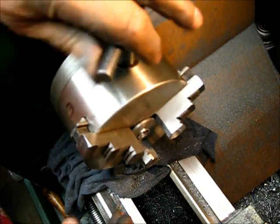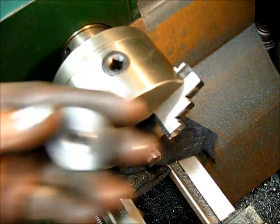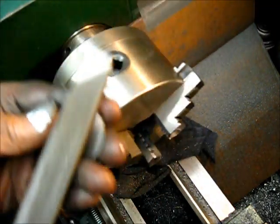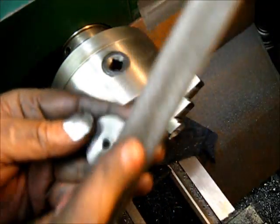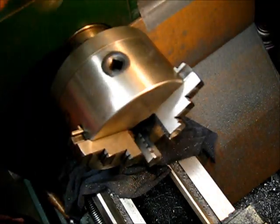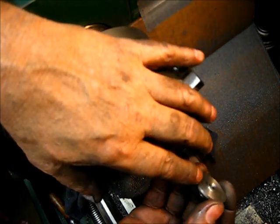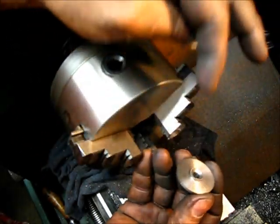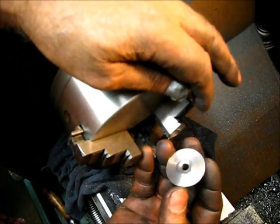This is actually not a very time-consuming project once you get started with it. I'll show you something — we got a little curled-over burr right there. You don't want a curled-over burr on your thing right there. Y'all see that? It's got that taper in there, and it's about a sixteenth long. That valve will stick out there about a sixteenth of an inch, and then that will be peened over and fill that little pocket up right there.